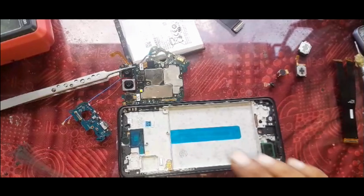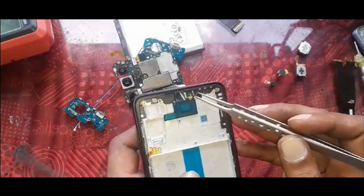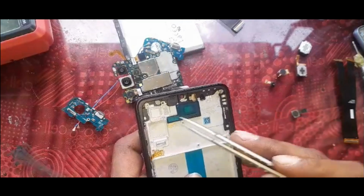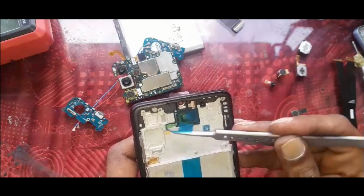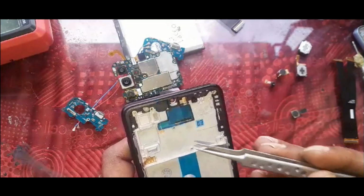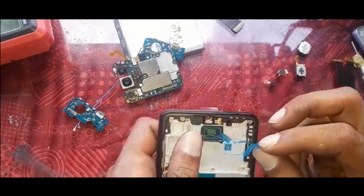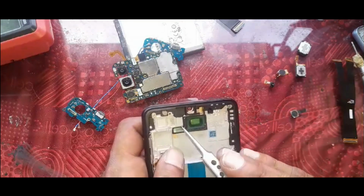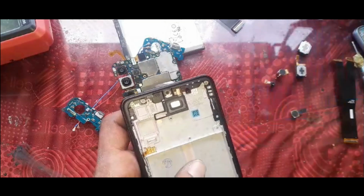As I always do, I've tested the LCD so I can peel off all these protective plastic cushions from the new one and leave the sticky things behind so we can stick those things. I've tested the LCD, so before you remove these, please test your LCD, so you shouldn't have problems later on if the new LCD is faulty. Sometimes they come like that, factory faulted.